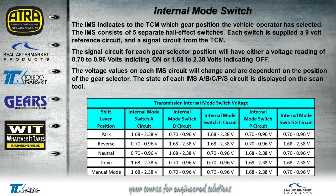The scan tool data that you're going to find on a capable scan tool when diagnosing one of these — you'll see that there are five Hall effect switches that are actually fed nine volts to each one. What's really odd is what the signal is supposed to look like to the TCM. It's not looking for zero or nine — it's looking for something in between. It's a real low voltage — it's looking for 0.7 or 0.9 volts when the switch is actually closed or on. And then it's only looking for 1.6 to 2.3 volts when the switch is off, so the computer knows what gear has been selected. You can see it's not going to take too much to throw this thing off and set a code.